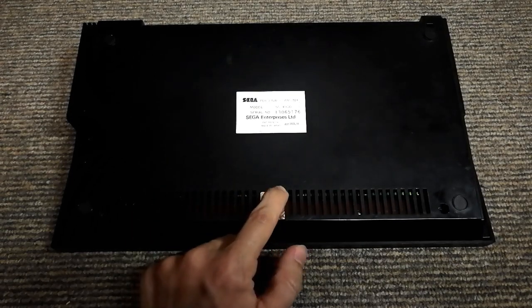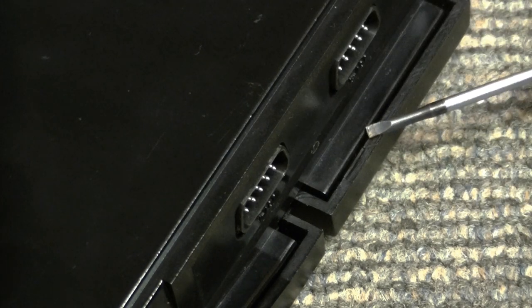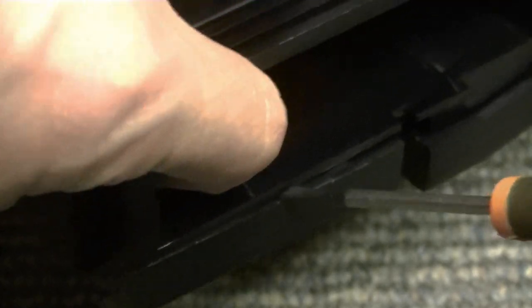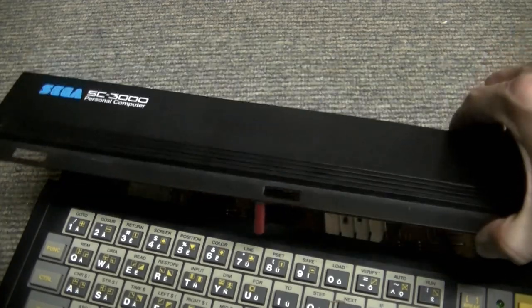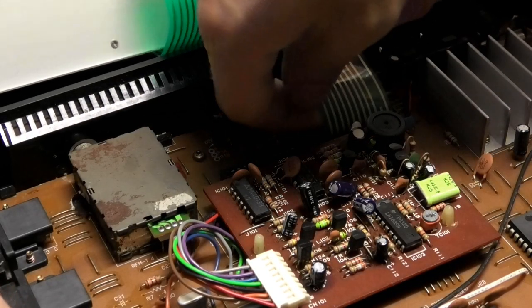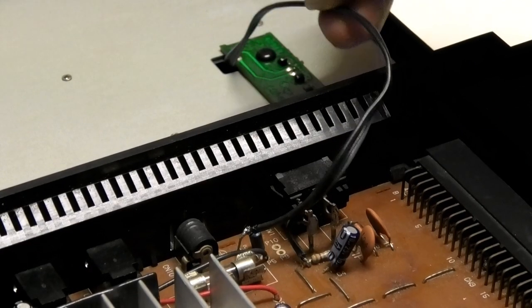Be careful from here about how you move it. Once the screws are removed, move to the joystick side of the system. You have to pry these two bits of plastic apart to release a tab, and doing it successfully should result in an obvious pop sound. Move to the other side where there's yet another tab but at a different angle. Once the system is right-side up again, you should be able to lift that top piece with minimal difficulty. When you lift back the keyboard section, be careful with these two ribbon cables as old ones could go bad and break easily.